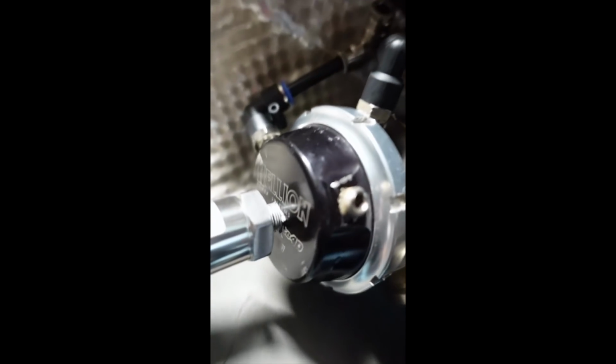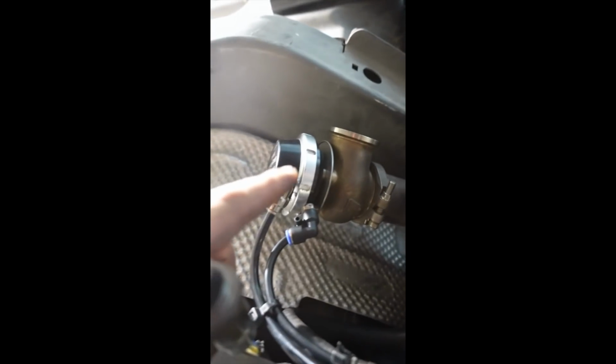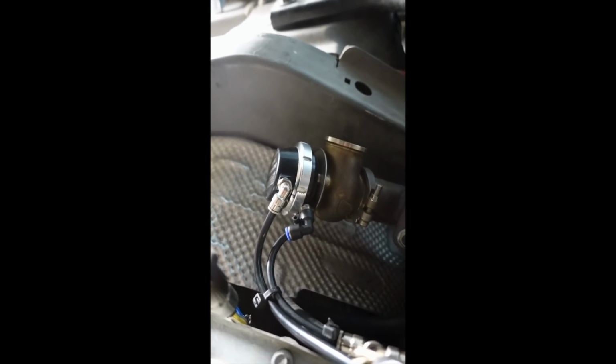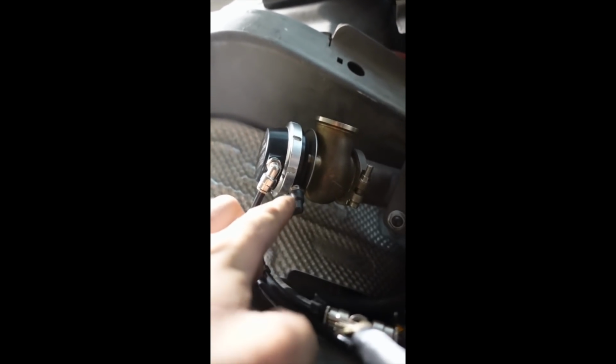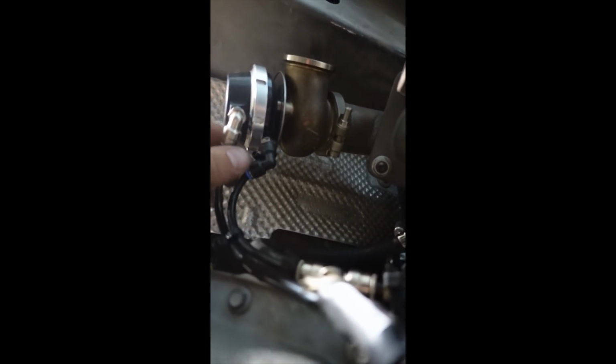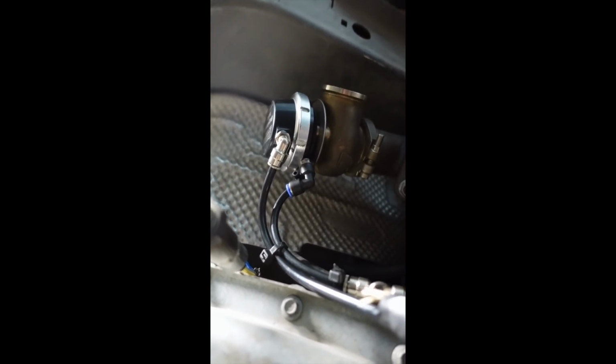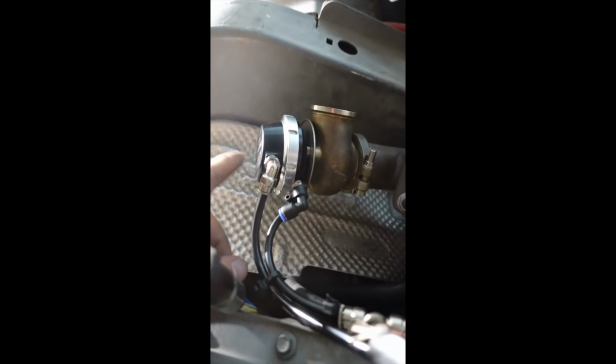And then to that gate, and then this T is going to be the one that goes up to the solenoid up top. And I got the, I don't know if I showed the dome pressure sensor, tapped it right in the middle, 1/8 inch NPT. And actually the reason why this fitting is different, and I gotta tell Johnny, not that it's bad or anything, but I broke one of these fittings off. So I told you guys I had to get 1/16 inch NPT fittings, and they only made them in this hard plastic, which is fine. It's a nicer material, but I believe they were Chinese made, and yeah, old buddy snapped in there.